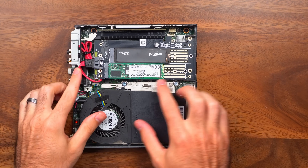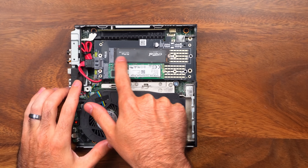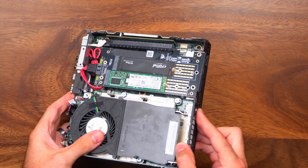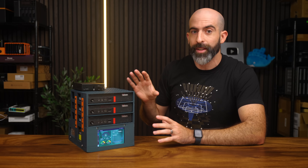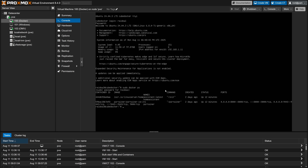Next, we're doing Proxmox. For this machine, I went with a pretty goofy PCIe card. Since I wanted a total of three drives — one for the OS and ISO storage, and two in a mirror for VM containers — I had to get creative. I got a card that has an NVMe slot and an M.2 SATA slot, with the SATA drive connected via a standard SATA cable. I did have to get a weird male-to-female SATA cable to connect to Lenovo's SATA adapter, and it just barely fits, but it works. I have a SATA drive for the OS and dual NVMe drives in a ZFS mirror in Proxmox for virtualization. I spun up an Ubuntu Server VM for Docker containers and installed Portainer for management.